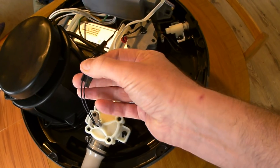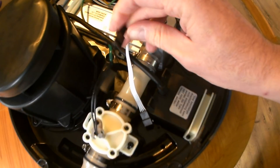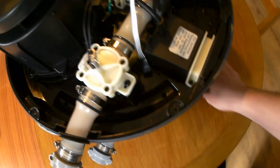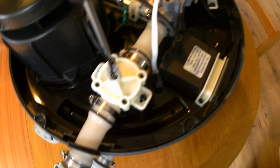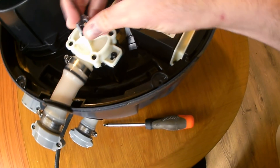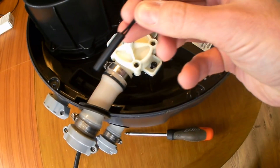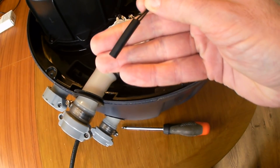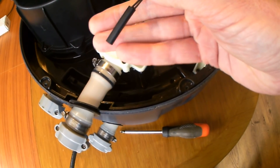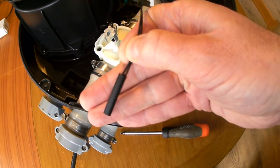You can see here I've already changed the sensor on this one once before. First thing to do is we unclick that — difficult to do with only one hand — and unscrew this little screw here. This is the sensor; the part number is linked in the description below. You can order one for around £10 in the UK. It's a magnetic reed switch. There's a magnet underneath in that little mechanism that closes this normally open switch.